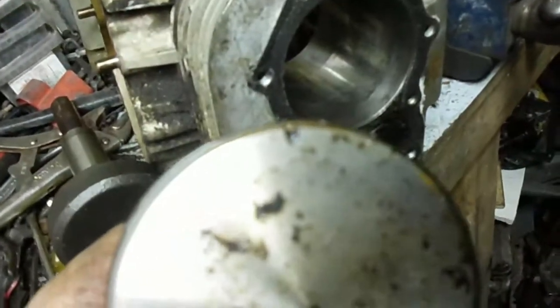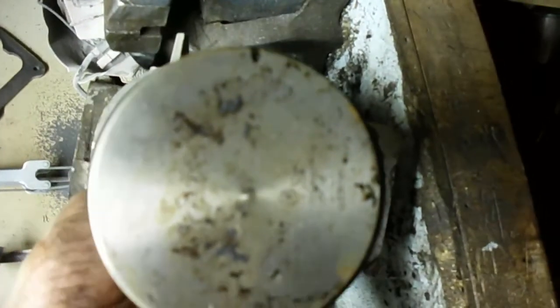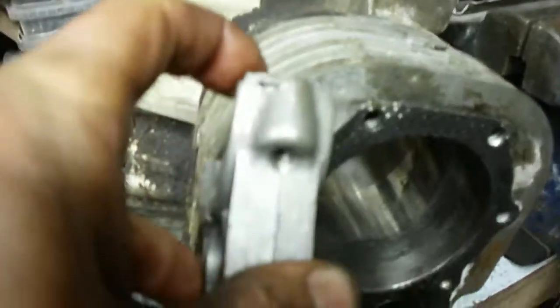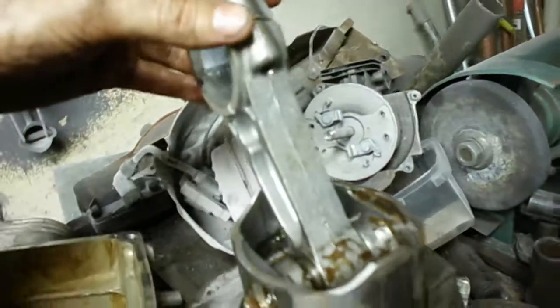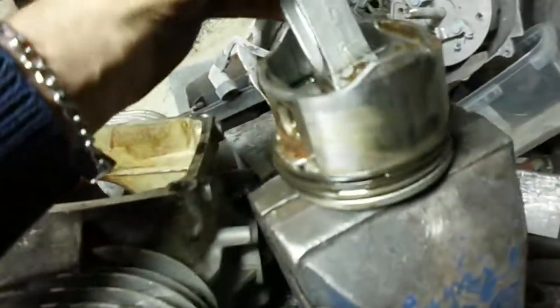There's a notch in the top of the piston that goes to the flywheel side of the engine. You've also got a little piece on there that lines up with a match mark on both halves of the connecting rod, and they face outwards - opposite to that notch in the top of the piston. Just some little details I'm mentioning because it's possible I'll review this video when I go to assemble this engine.